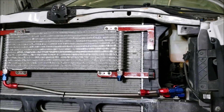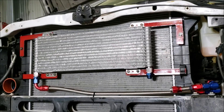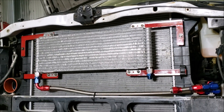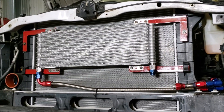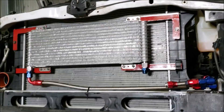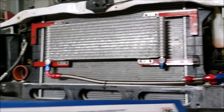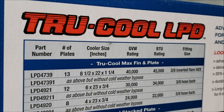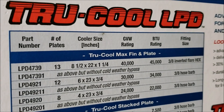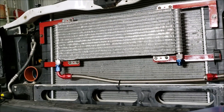That's a longer story we'll catch you up on later. What we've got in front of us was an attempt to correct that — this is a TrueCool 47391. The '1' on the end designates it as not coming with a cold weather bypass. The cold weather bypass version is the 4739. This has 13 plates, it's 8.5 by 22 and one-quarter inches thick, and it does fit in the factory space between the intercooler and the radiator.